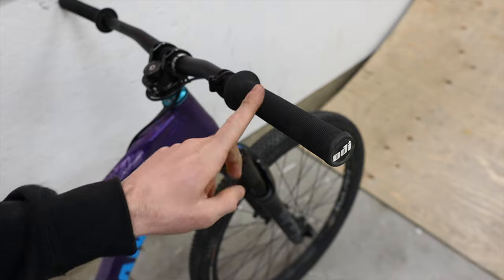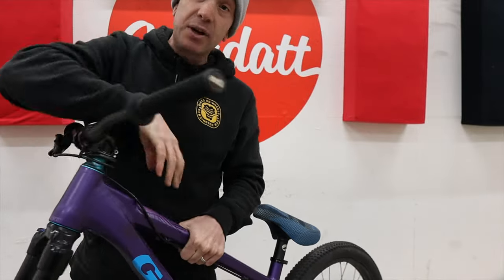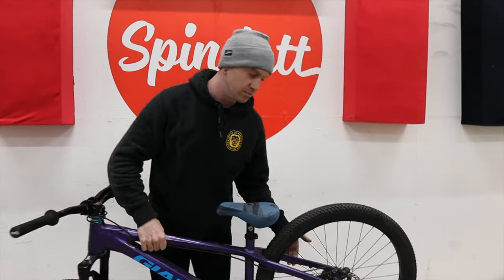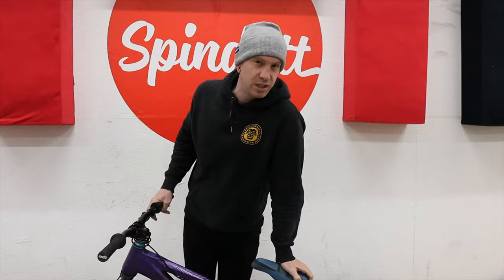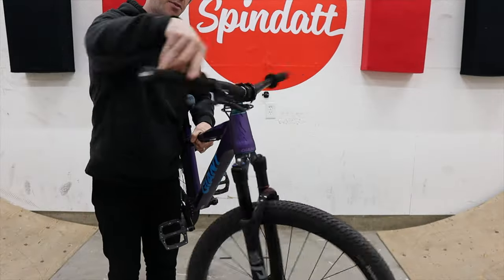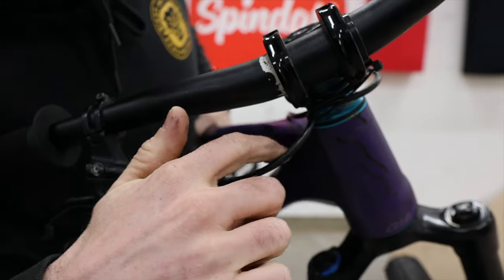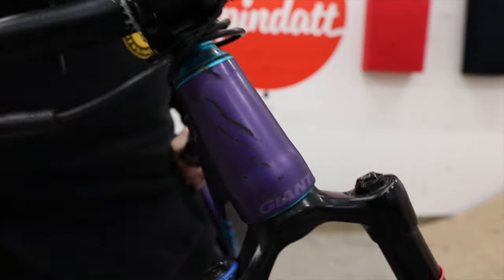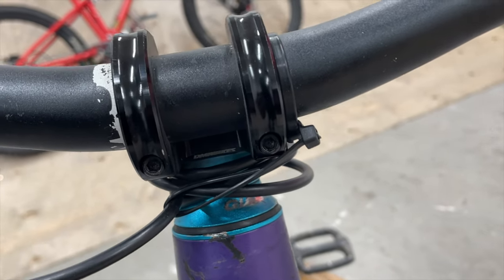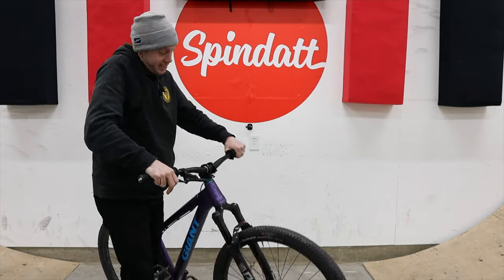These are the extra-long ODI Long Necks. The rear brake works very poorly — it's a TRP Slate lever with a now-kinked hose and a Shimano MT200 caliper. They don't work well at all, and that's the next thing I really should sort out. Because I bar spin to the right — I throw with my right hand and spin clockwise — I don't like the angle the hose comes out when wrapped around the steer tube. So I've got a zip tie on my bar and a zip tie here pulling the cable so it doesn't come back at a really extreme angle. Niche information, but information nonetheless.